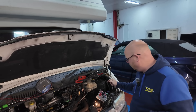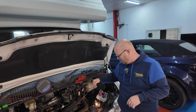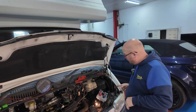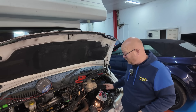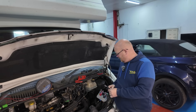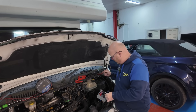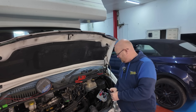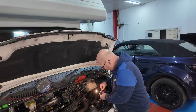So I'm not going to isolate that circuit that way. What I'm going to try and do is isolate the circuit straight out of this fuse box. If I start pulling some plugs, when that bulb goes out I know it goes down that wire and I just have to find out which pin on that connector feeds everything. Then I can literally trace it from that loom and follow it around to see where it's going.